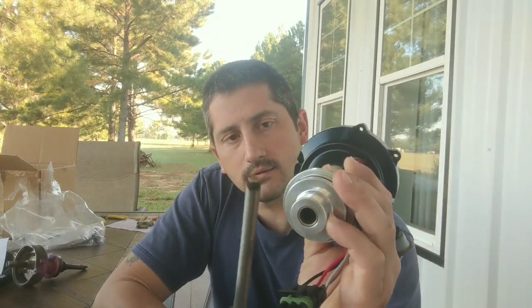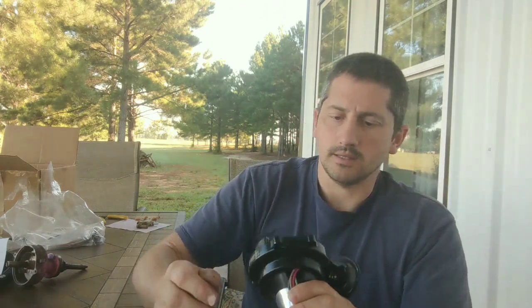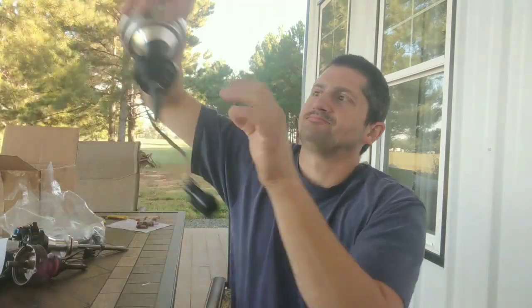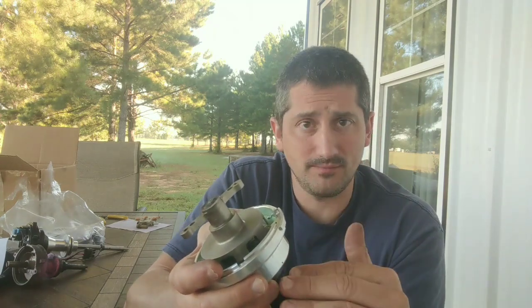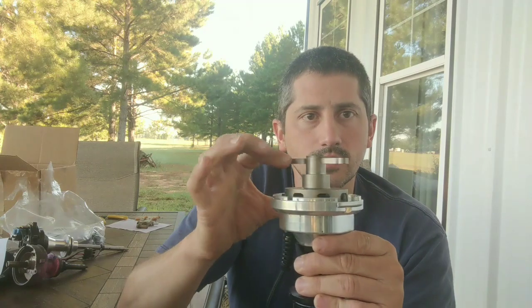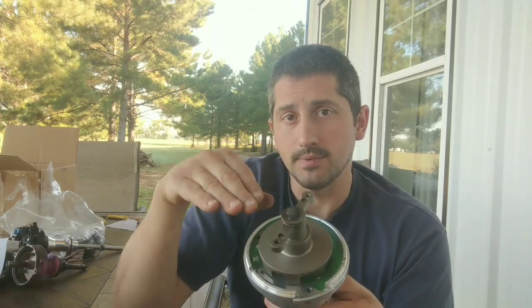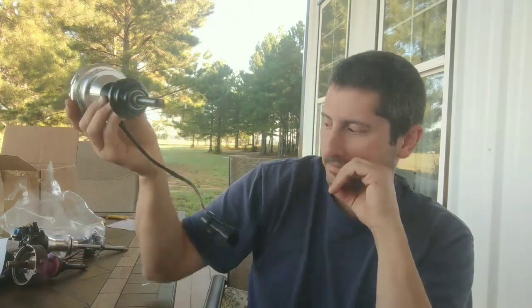So what I did was I basically cut the top off. This is a Holley base and that has a bushing in it. I used a Dragonfire roller bearing. I have a two-tone distributor now for my setup, which is right here. This is the Dragonfire base and this is the Holley top, and they bolted right together. It's the same manufacturer, the same specs. I'm pretty sure that Holley made these — they were made overseas and then shipped to the United States to be assembled. And right here, as you can see, is your crank and your cam. It's a very simple setup. I found it online for $190, and it was actually for a big block, and I made it to fit a small block.